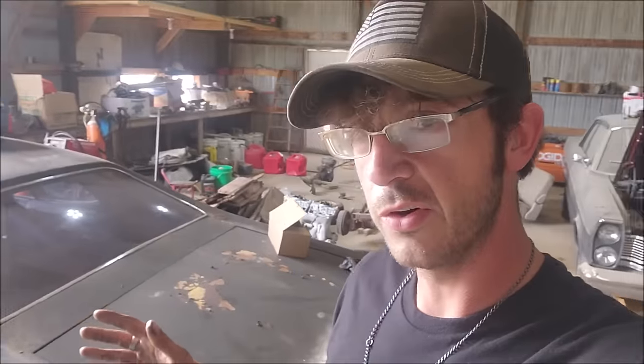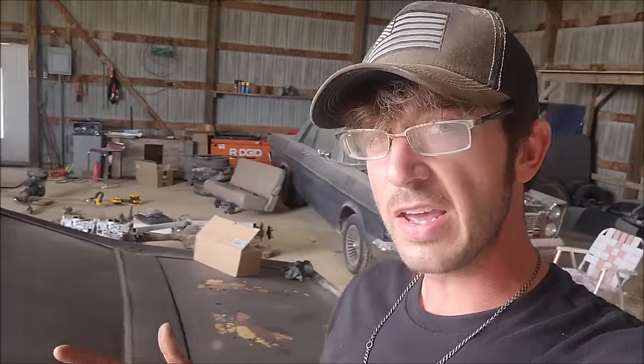Interesting. So I think at this point we can deduce a pretty likely story as to the history and background of this 70 Torino drag car. If I had to guess, it was a pretty decent, nice car at one point. It was painted yellow. Everything on the build sheet from the transmission back looks to still be the same. Now, everything from the transmission forward, as far as the engine is concerned, is different than what's on the build sheet. It is definitely a 429, but it's like a stock one with a mild cam